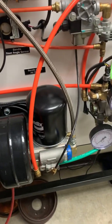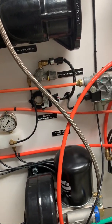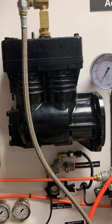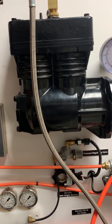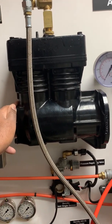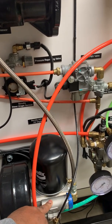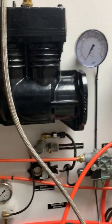The governor is extremely important because compressors are not meant to have a hundred percent duty cycle. The more often they actually have to work and build air, the more likely they are to have a premature failure. It's not uncommon to have a compressor last almost the life of a truck, but if you have leaking air or a governor that is not working properly for extended periods of time, you could potentially burn out the compressor faster than normal.